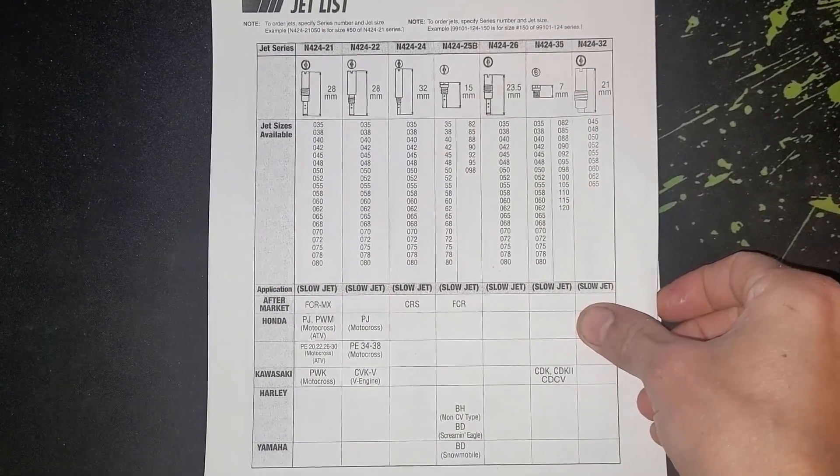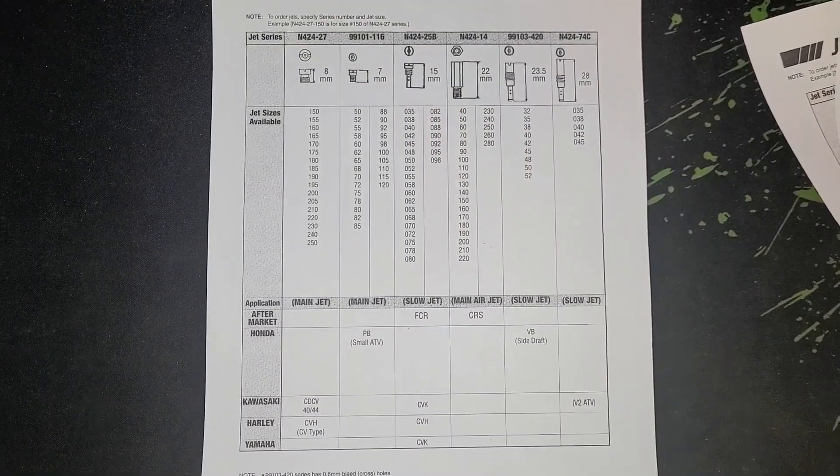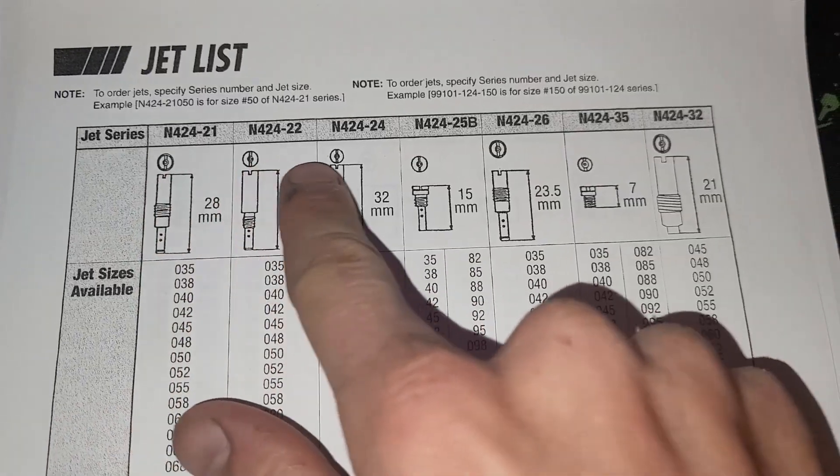If you're working on a dirt bike, four-wheeler, or motorcycle, you want to use genuine Keihin jets or Mikuni jets. The genuine jets can get expensive, but there are high quality aftermarket replacements that aren't as expensive — Sudco, JD Jets, Dynojet, and I think All Balls makes some jet kits too. This is how I buy my jets: you can get a jet chart that tells you every single jet they make for the model of carb you're working on, with all the different sizes and part numbers.